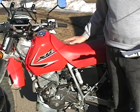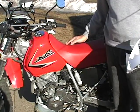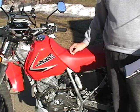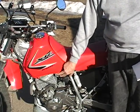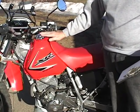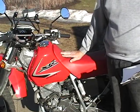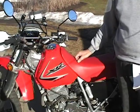According to the owner's manual, the tank on an XR650L holds 2.77 U.S. gallons, with six-tenths of that being reserved. The problem is that 0.6 gallons is not always capable of reaching the fuel pickup on the left side of the tank. Therefore, you can only use 2.1 gallons out of the tank. You go on reserve at about 85 miles with the stock configuration, and you run out of fuel at around 115 miles.